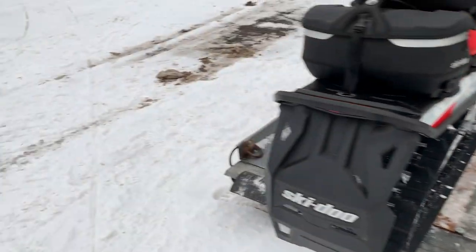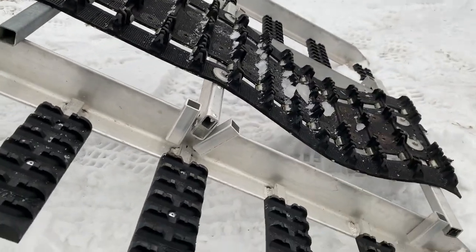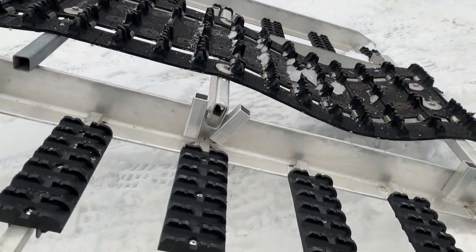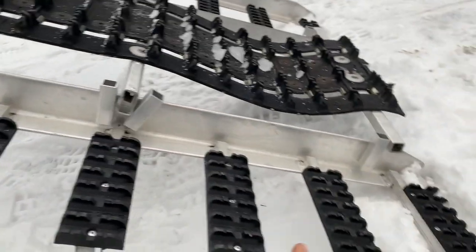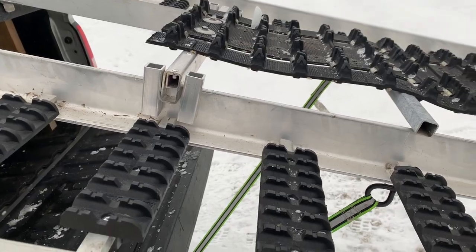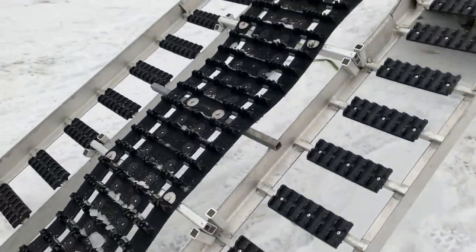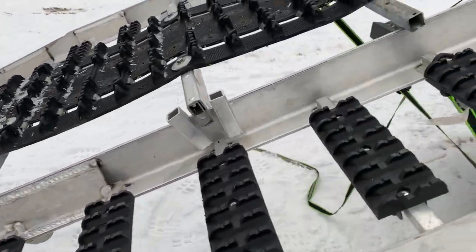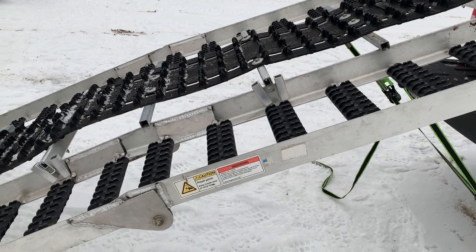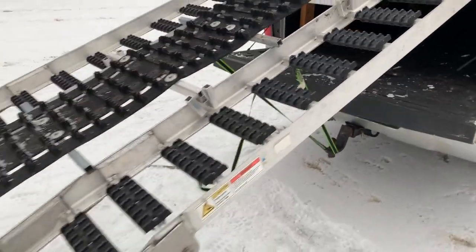This day is pretty well done. I just unloaded the backcountry off the truck and wrecked all of these. Obviously a rivet's not going to do - I was coming down with too much speed, tapped the brake, and of course it engages in the lugs of the traction mat and rolled all these. One rivet's still holding on all the back ones. I'll have to drill it out and maybe through-bolt it, something a little stronger. It happened on both sides. The clutch engagement's a little quicker on the backcountry than the Scandic, and I tapped the brakes and they all bent, broke a rivet and pivoted. So another project.